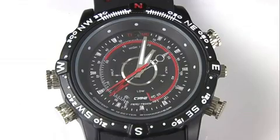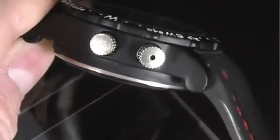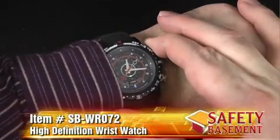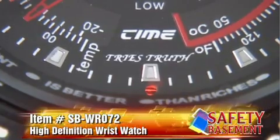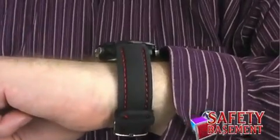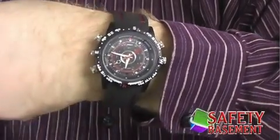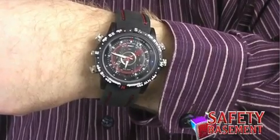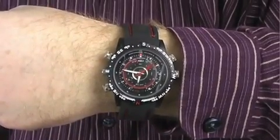Now let's shoot some video. Before we actually shoot video, we should remember to put on the microphone knob — it's the knob with the small hole in the center which lets the audio in. Then press the power button. The status light will turn blue, then red. Since red is video mode, we're ready to shoot our video. Turn your wrist and aim the watch face at the object, and quickly press the power button. The red status light will blink a few times, then go out. The status light is on top when you have the watch turned.